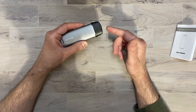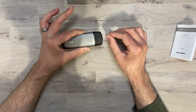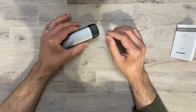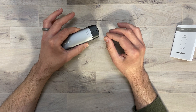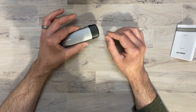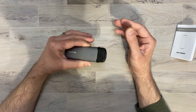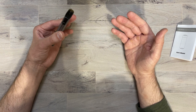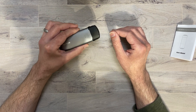You can put up to a two terabyte NVMe in here. Keep in mind, depending on which cable you use and the type of NVMe, you might get different speeds. This NVMe is capable of much more than 10 gigabits per second, but that's all this enclosure can handle. Conversely, if your NVMe is slower than 10 gigabits per second, the enclosure won't boost it — you'll only get what the NVMe itself is capable of.